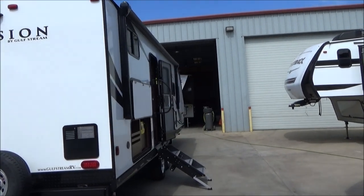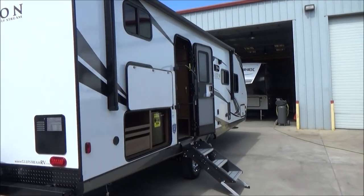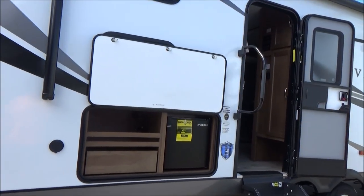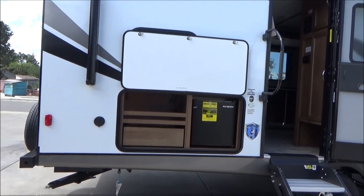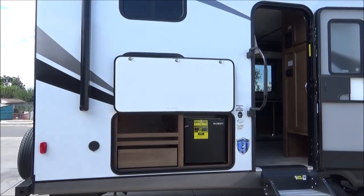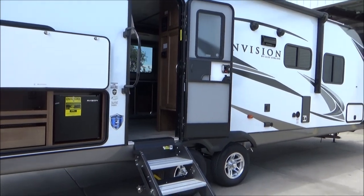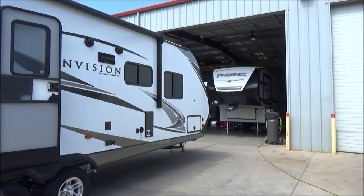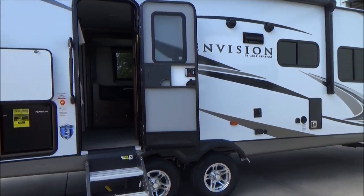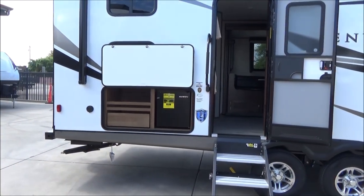And we're back around this side where you see your small little outdoor kitchen. Just everything that you need. It's a refrigerator, a shelf to set stuff on. You got some electricity. Below that, you have a quick connect LP line for any of your appliances that use propane. You don't need to haul any extra propane. You can go ahead and tap into the front bottles. But remember, that's already a low pressure regulated line. You need to remove your regulator off any appliance that you put onto that.